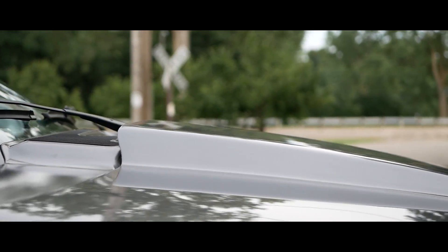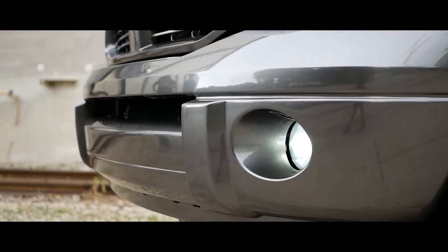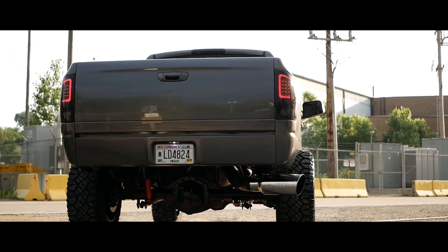I put a steel cowl hood on it, and I converted the front end over to a sport front end, so I put a sport grille in it and a poly sport front bumper. I also put a custom roll pan in the rear. Usually the roll pans have a cutout for the spare tire crank, but I took that off because you can't run the size spare I have under there anyway. So I filled that in with a patch panel to give the rear roll pan a smoother look.